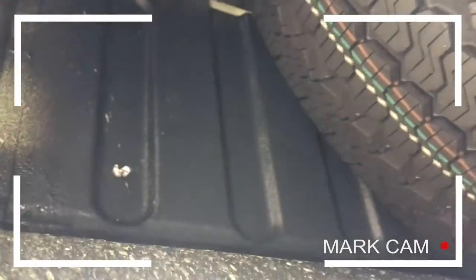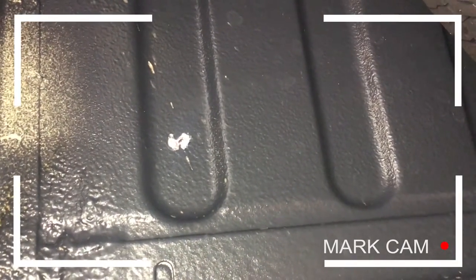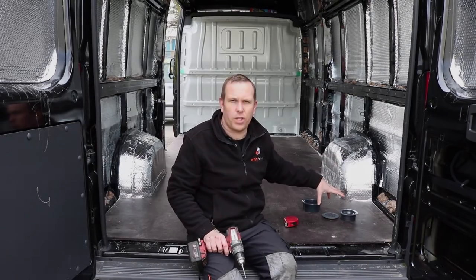Okay, that's the pilot hole done. Looking under the van — it's quite hard to see, but you can see the tyre here. You can see the hole where it's come through on the middle of the rib, so I know that the position is good and that's corresponding to the hole in the top. Around centre on that hole, we can see it's going to fit right there — perfect position. Once we've done all the pilot holes for all the vents, we can lift the floor up, take it out, and start looking at cutting our larger holes.